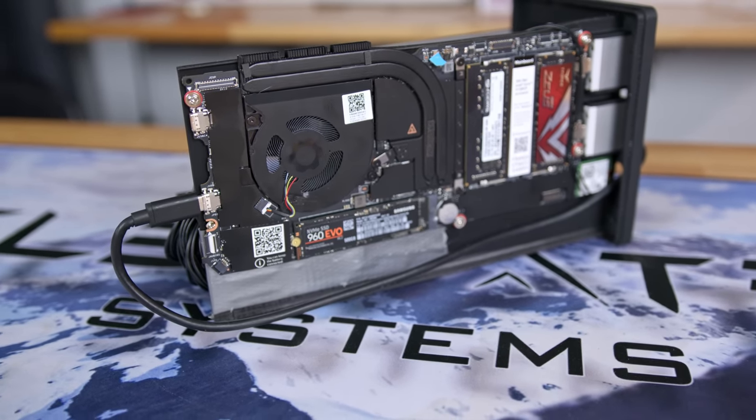For those of you looking to craft your own iteration or tweak the blueprint, once I'm done fixing up this printer and confirming the revised model is mistake-free, I'll be dropping the STLs along with the CAD files on my GitHub — link in the description as soon as those files are live. The PCIe adapter aspect might be a bit of a hurdle for DIY folks. I wouldn't advise shelling out $400 to $500 on an eGPU enclosure only to yank the PCIe adapter out of it. While you could potentially find these Razer enclosures pre-owned for less than $200, that's still a bit wasteful unless you've got a plan to repurpose the remaining components. Unfortunately, while there are alternative solutions — both Thunderbolt and M.2 adapter options — none that I came across could provide the necessary 100 watts of power delivery to the mainboard, and those budget M.2 adapters without any extra power input simply don't have enough juice to power the graphics card, so it's best to steer clear of those.